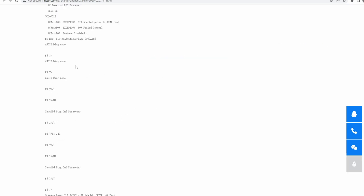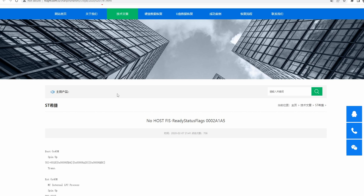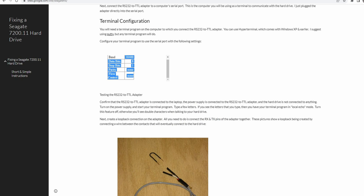This error message helped me reset the hard disk. The drive is now fully backed up. It's nearly 12 years old and was only used for backup purposes. It showed symptoms earlier — vanishing from Windows, not entering BIOS — then started showing again, but folders would auto-close and Explorer would restart. If you face these symptoms, reset the drive to the first stage and back up immediately.